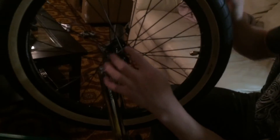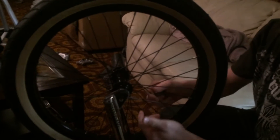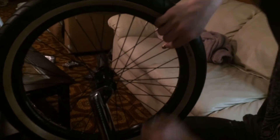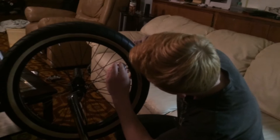There's one side of spokes on one side and then there's another side. When you're tightening, you want to start with just one side and not do the other side — you'll wait to do the other side when you're done with the first. I use this as a starting point because it makes it a lot easier when you're going around and tightening them. You want to turn them all about half a turn.